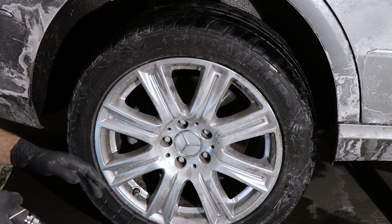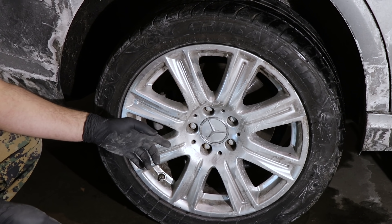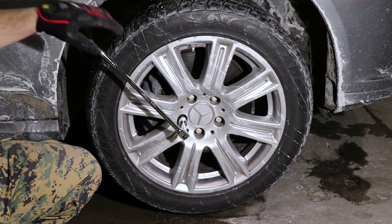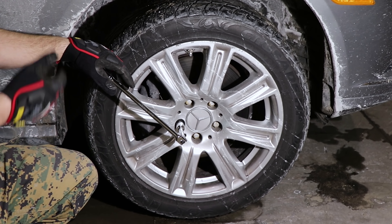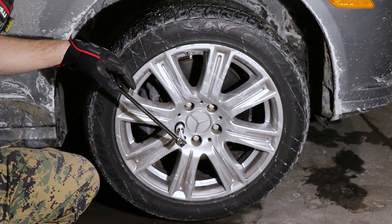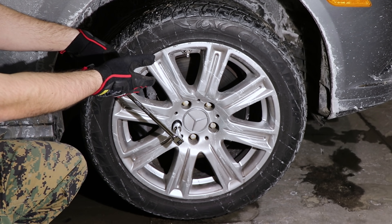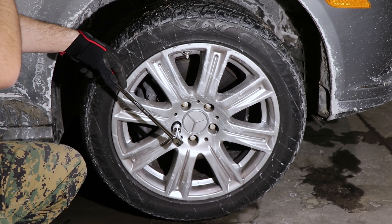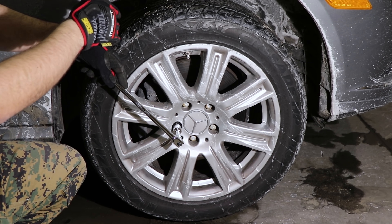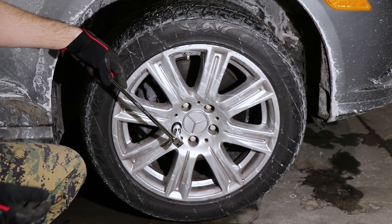After you do all the tires, it requires you to drive a couple hundred miles — I would recommend 50 to 100 miles — and then if you have a chance, recheck them again just in case. I finished the driver's side rear tire, changed the pads, and bled the brake. It doesn't need to be bled as extensively as the rear passenger one because the line from it is much shorter. This is the third tire I'm doing — I did rear passenger side and rear driver's side, and now this is the front passenger side. Then I'll jump over to the driver's side front, which will be last because it's located closest to the brake fluid reservoir.